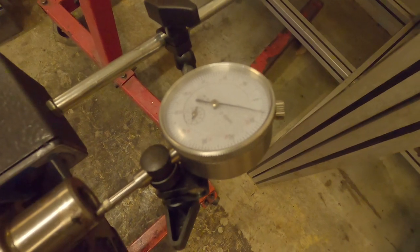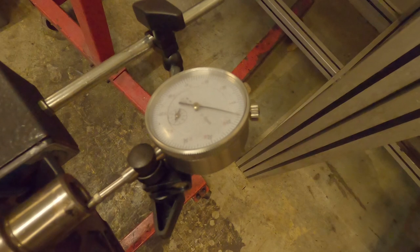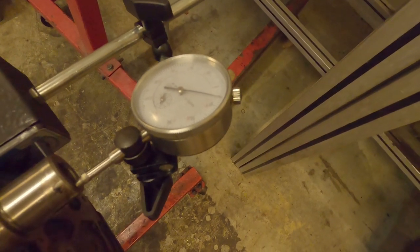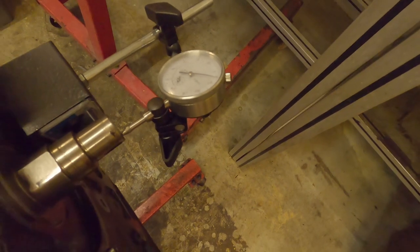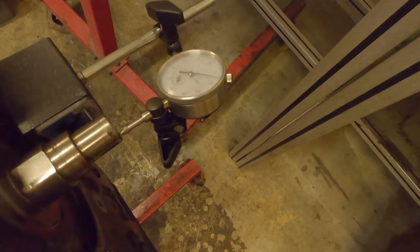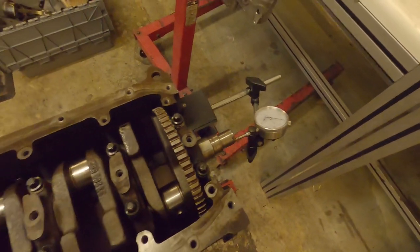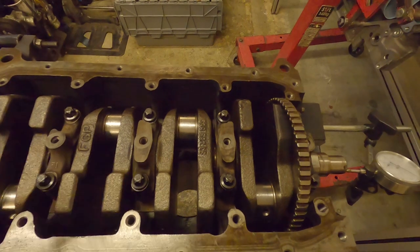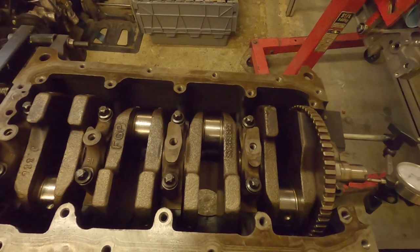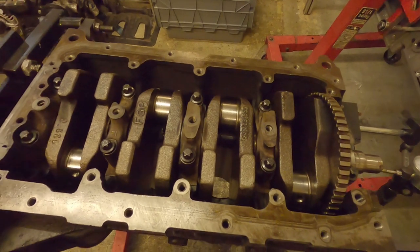I like to aim for the middle of the allowable range. If you have problems where you're moving too far, it means your crank is either worn or your bearing is too thin. So if you have the option of going for a thicker bearing, go for the thicker bearing. If you haven't got an option for a thicker bearing, it probably means your crank is worn and sliding around too much side to side — and at that point, your crank's no good and you need to replace the crankshaft.